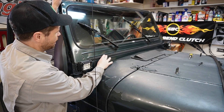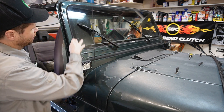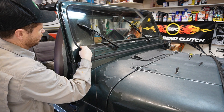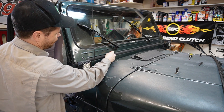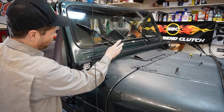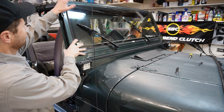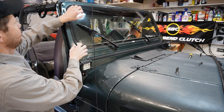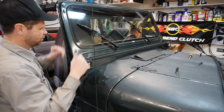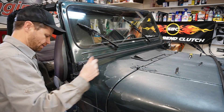I want to replace the gasket here. Obviously take the windshield wipers off, but this gasket around the window — I don't need to replace the windshield, so I'm going to leave that gasket in place. But this one is brittle and dry, so I'm going to replace that. I'll fold the window down, take off the windshield wipers, take this gasket off. I think I'll leave the windshield frame on. Let's start by taking the windshield wipers off and actually get this antenna out of the way real quick.